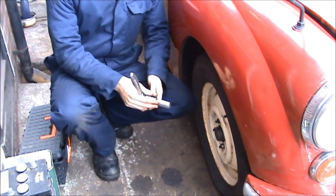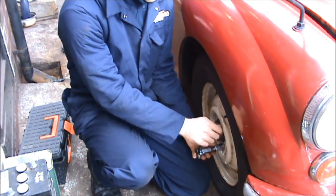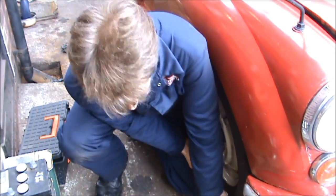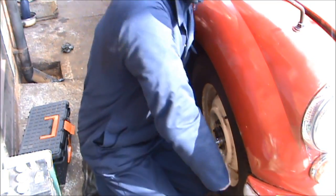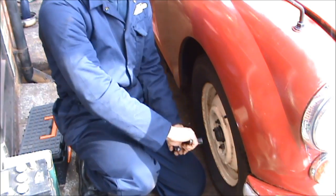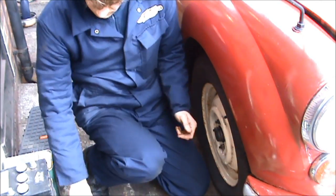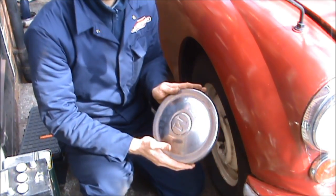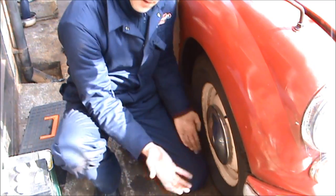So with the car now back on the floor, I need to tighten up all the wheel nuts around the car one by one and refit the hubcaps. All you need to do is tighten it up — it doesn't need to be overly tight because you don't want to strip the threads on the nuts. Again, go top to bottom, side to side with your tightening. Go around maybe two or three times and just see if it'll go a bit more. That one's tight, that one is — I'm not getting any more on there and it doesn't need to be any tighter, so I'll say it's done. To refit the hubcap, get it onto the little tabs that are on there and then a good whack with the palm of your fist — hubcap's on, nice and simple.